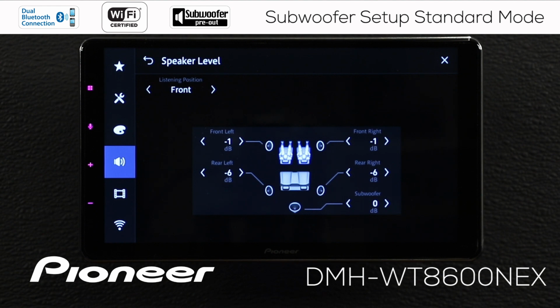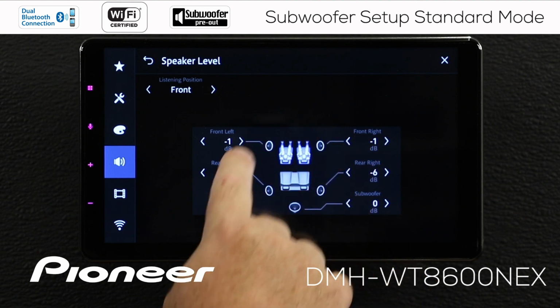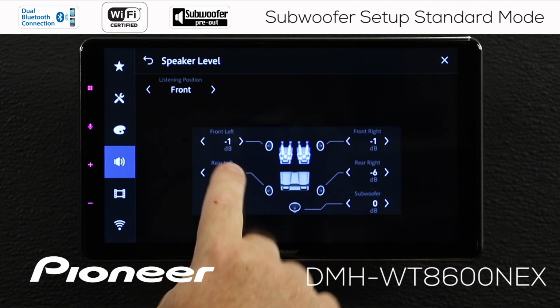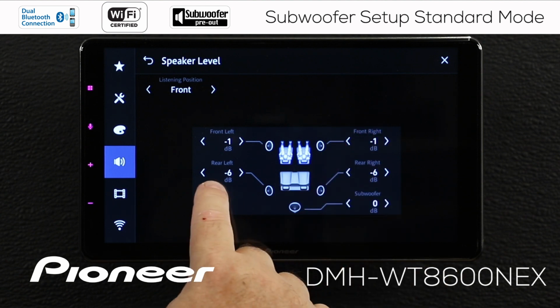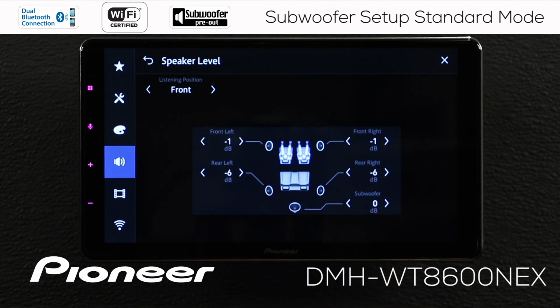And under speaker level, you can see that we have an individual volume control for each speaker in the system. And of course, we said at the beginning of this video that this system is set up in standard mode. And standard mode means front outputs, rear outputs, and a subwoofer output. So here are the independent volume controls for my front right and left outputs, my rear right and left outputs, and my subwoofer output right here.